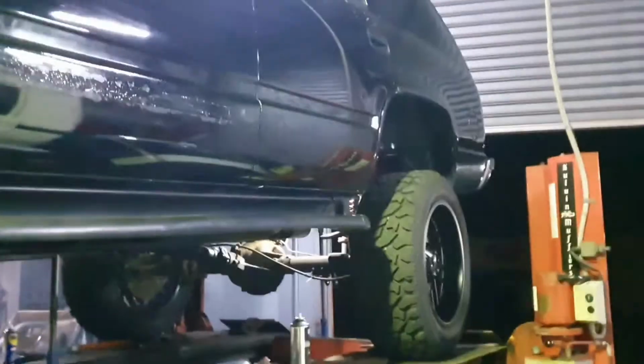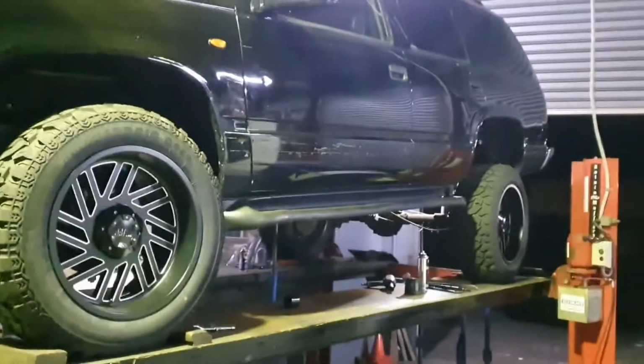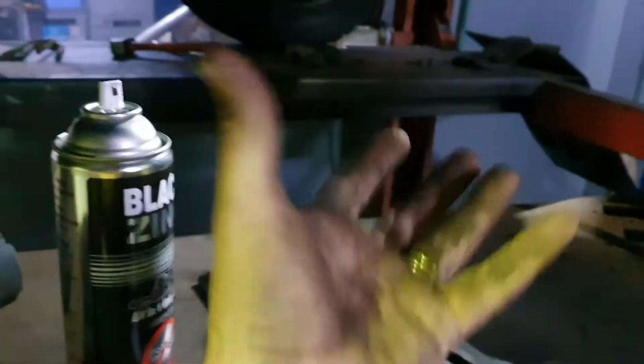Okay, this is where I'm at. There's a long way up to have my little truck. I had to jack that up to unload them springs. They took a lot. There you go, the block's in there. I've cleaned up the top plates, slapped some paint on them, got my new U-bolts, tub of anti-seize. I got the lower piece that goes up underneath it, this all bolts into, just out getting painted.